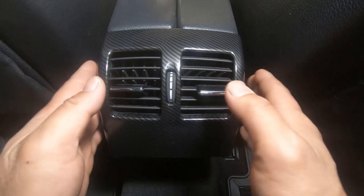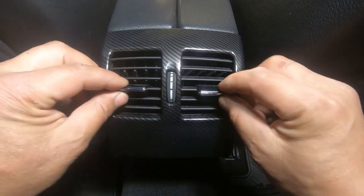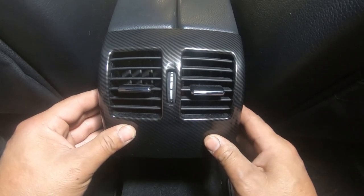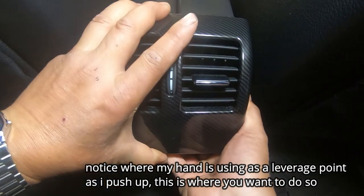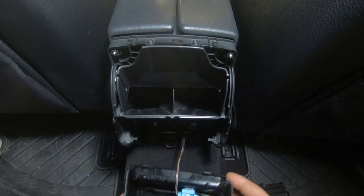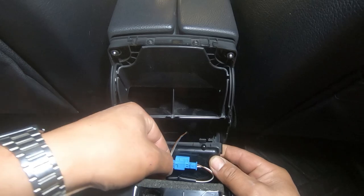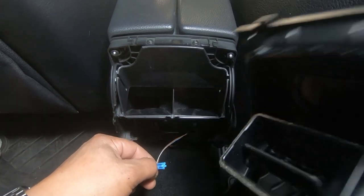In order to remove this it's really quite simple, however you're probably going to struggle if you've never removed it before as it will be very tight. All you have to do is push in a little bit and then slide it straight up — push it in and then slide it up and there you go, it unclips. Now you have access to your rear AC connection. There's a tab here — just press on that and unplug it and you can remove the entire rear AC unit.